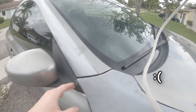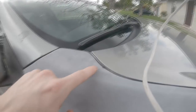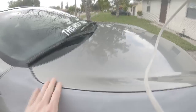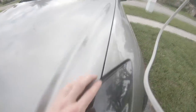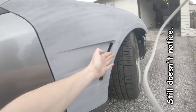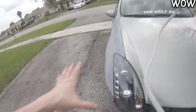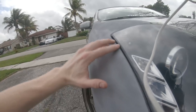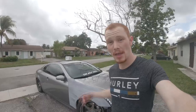Up here on the line was the most difficult part — I had to grind a lot of it down using my Dremel and then fill it with Bondo. There's still some tweaking to do; this side needs to be pushed down a little so it's nice and even. There was a huge crack right here that I tried to fill, but once I fit it back on the car the crack started coming through again. Along the hood, the hood line is almost perfect — I'm really happy with how it came out. The fender is a little bit wider but not a wide body kit, maybe half an inch, and you get some nice cool little vents. The car was in an accident before, so lining up perfectly with the headlight is difficult, but up top everything is flush.